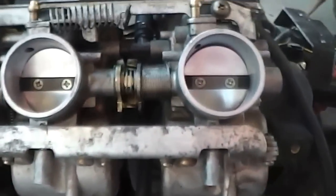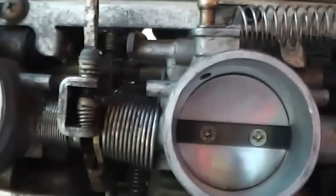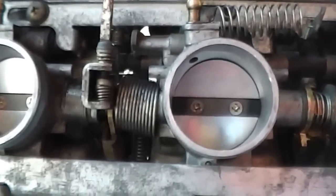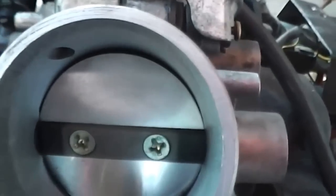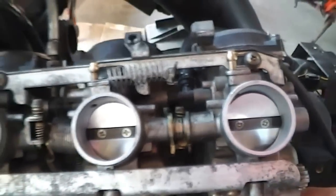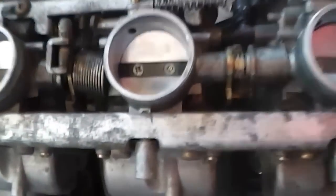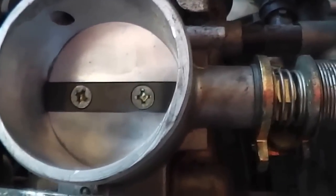What I do is I've just screwed the screw out on number one — screwing it counterclockwise opens the throttle up on number one. To close the throttle you go clockwise. So we want to open the throttle on number three and number one to get number two back into its neutral, unhindered position, so it's not getting any influence from any of the other carbies. I'm going to screw this counterclockwise about three or four turns. Now I'm going to unscrew the idle until the centre carbie sits against the housing of the actual barrel itself — closed off completely.